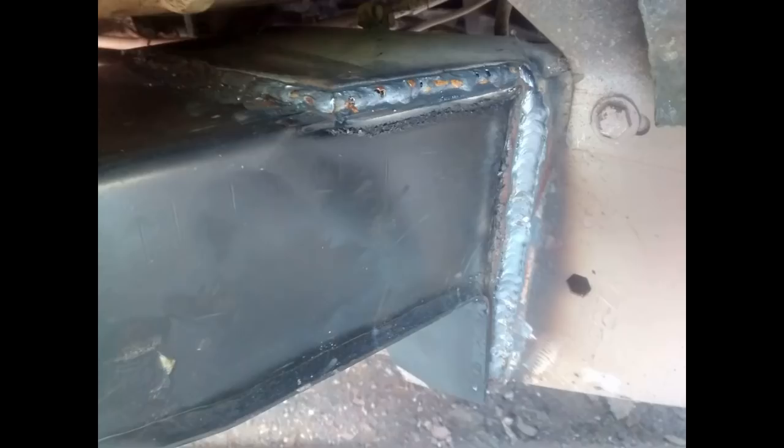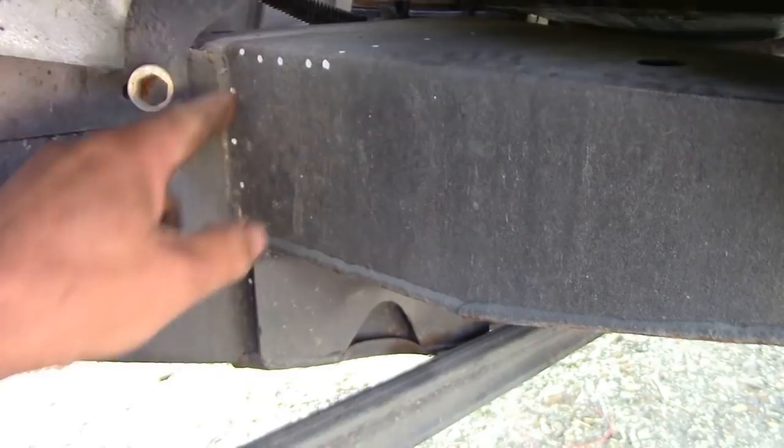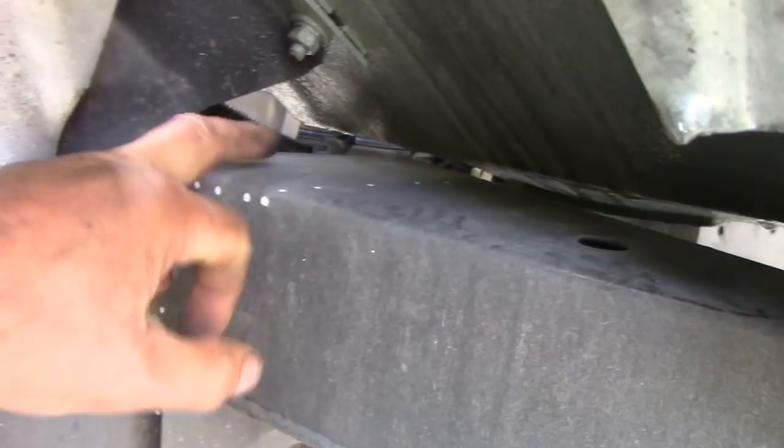So here's a cheaty way that I do them. See these little dots here? This is where I cut. I cut down here, across here and across the top. I leave this bit on, because 90% of the time this bit's okay. That allows me to put a big patch underneath.